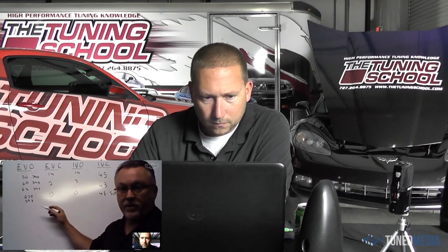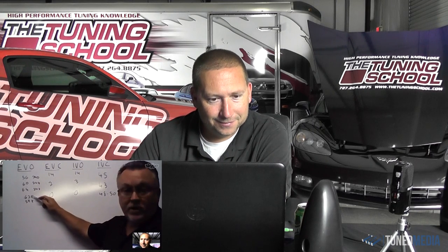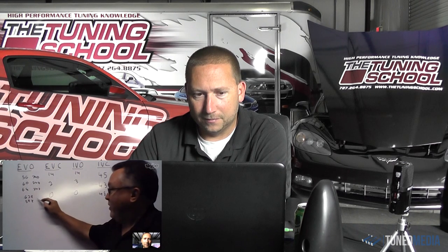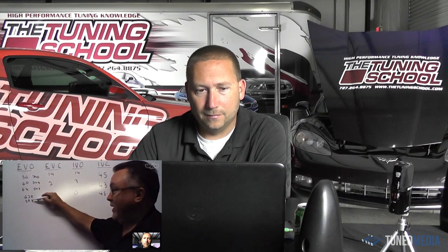Lift. We tested exhaust lift on the same engine. We're still talking about this naturally aspirated LS3 engine, and I'm sorry to derail your boost discussion, but this is relevant to the boost cam. So we tested 620 some exhaust lift. We tested 590 some exhaust lift. Guess what? This one made more power. The engine made more power everywhere with less exhaust lift. It liked duration. It didn't like lift.